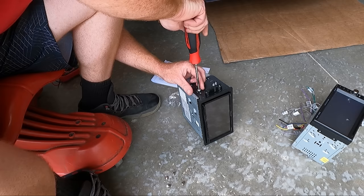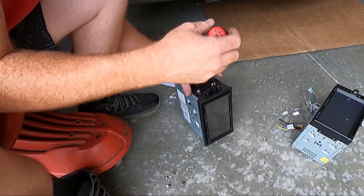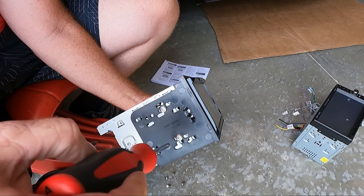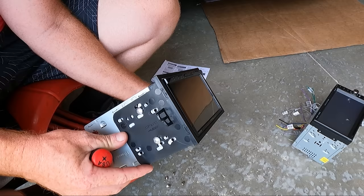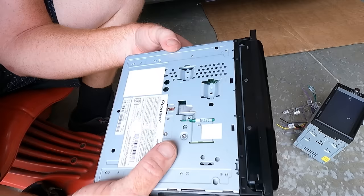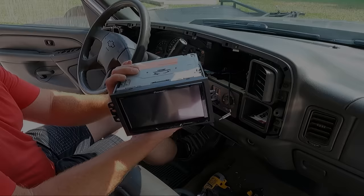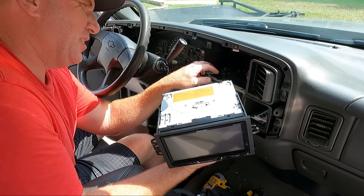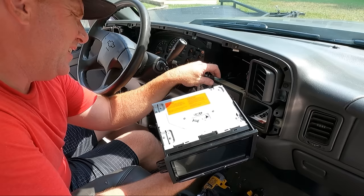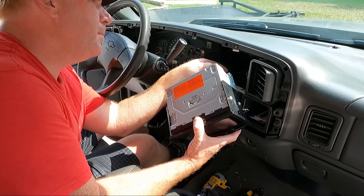I'm going to go grab the ones that came with the actual radio. It looks like it fits in the dash with these button-head screws. It comes with a recessed set if you're working with really tight areas. I want to be able to drag it out some, so we'll put them in there and adjust it. I'm going to back them off just a hair and move it up to where it's flush — you see how much it was sticking out; that would drive me bananas. So we'll loosen it up, push this out where it's nice and flush on both sides, tighten it back up. See how flush that is now — nice and even all the way around. Let's go see if this thing will go in the truck.